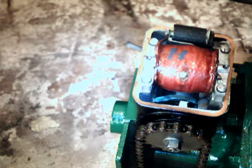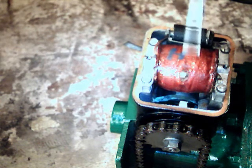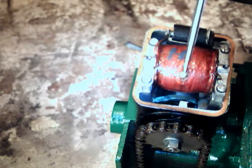If you take the top off, you just loosen these two screws and the Bakelite cover comes off. In here you've got the main ignition coil there, and that's the actual terminal where the spark comes from. There's the main ignition coil and there's the condenser. And as you all know, the points are in the back here.